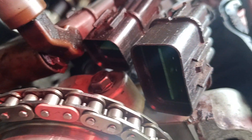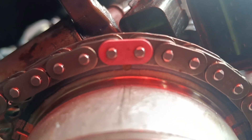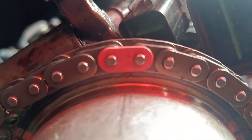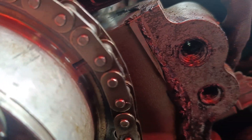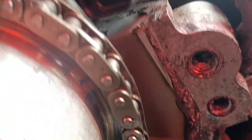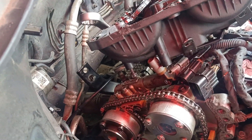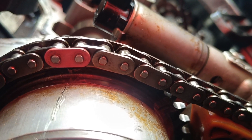We also have three marks on this sprocket. Then we have the dot marks — you have the dot mark on the chain and the inlet, then you have the third mark here and the sprocket. So guys, that is bank one for you over there. Then we have bank two, which also has the same three marks using the dots.